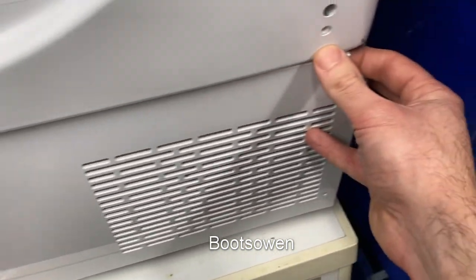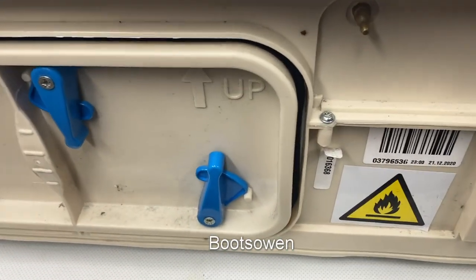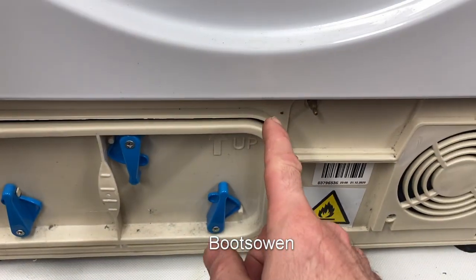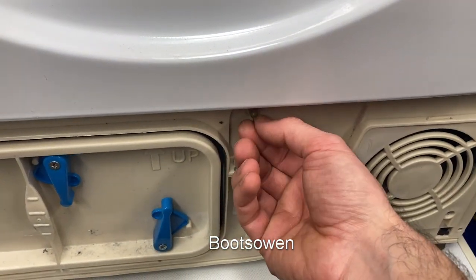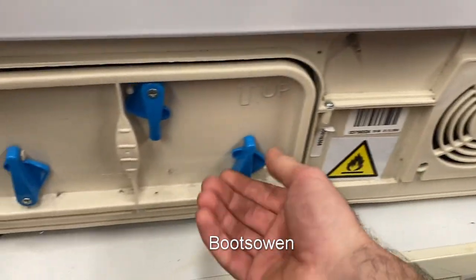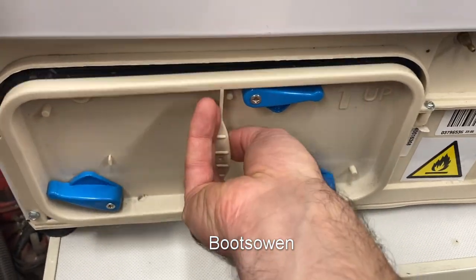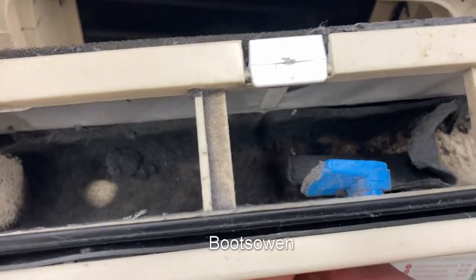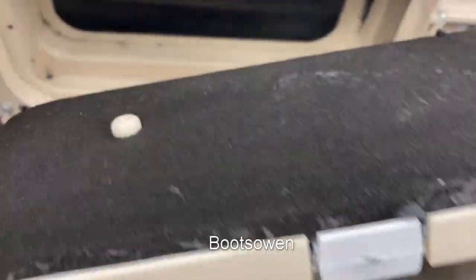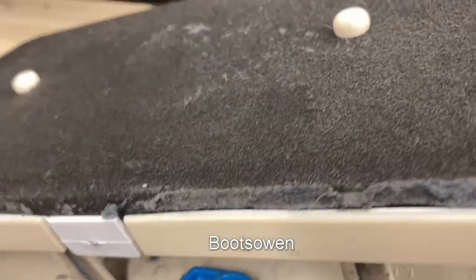Then down the bottom, I'm going to push it in the centre. Sometimes they pop open, and here — grab it on the side. This is an integrated appliance and other machines may have different ways of getting in. Sometimes they have a button to pop, but this one bears on that little brass knob there. Just grab it at the side and pull it out. Three little levers, and then this is the second filter in here — full of fluff again. And the third filter here, with moisture on it and more fluff around it.